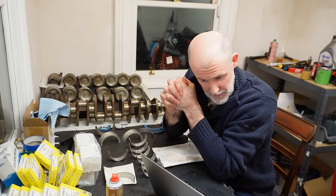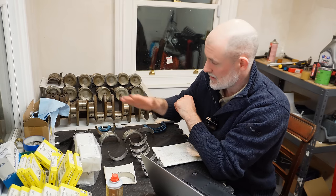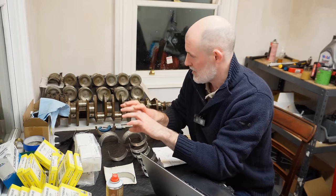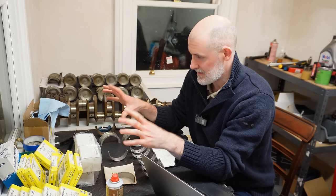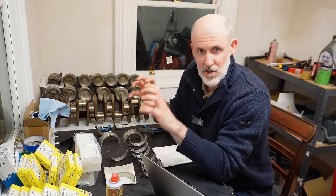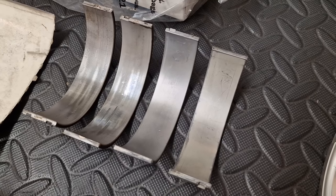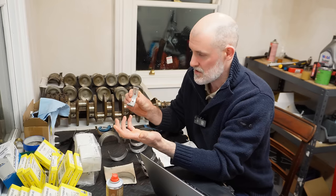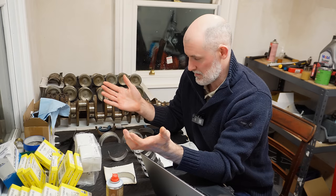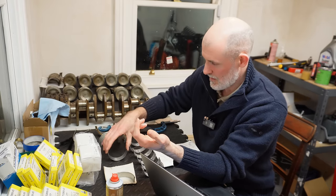The hydrodynamic pressure wave of the oil will locate the crank relative to the bearings, so it's not going to cause any kind of excess wear. Essentially, the crank centers itself within the bearings, and the wave of pressure that the oil produces keeps everything centered. Everything does change shape on an absolutely microscopic level, and everything essentially self-centers to an extent. The differences we're talking about are so minute, it's not going to be an issue. I would not be happy doing this if I thought it was going to be a problem. But like I mentioned, the reality is you cannot rebuild an M70 without doing what I'm doing. It's just not possible anymore.